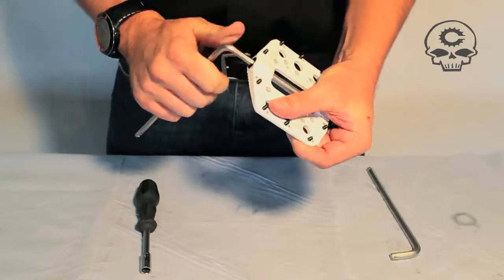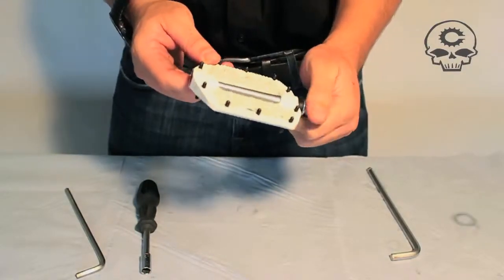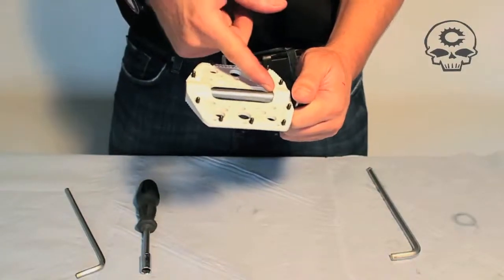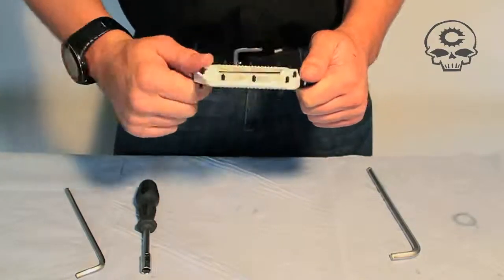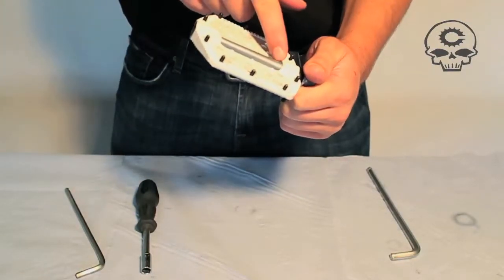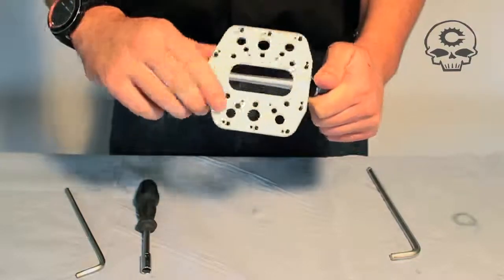The only issue you see with crampons because of the open spindle is sometimes if you leave your bike in the rain, or if you've washed your bike and let it dry without lubing, you might have a little sticky spot near your DU. Your pedal will be really resistant to the spin. So just take your chain lube bottle, drop a little drop right there and force it to spin around a little bit, and it will work its way through into that DU and then you'll be ready to go.